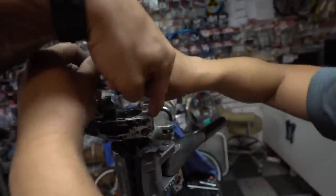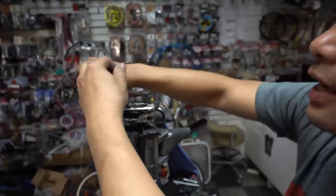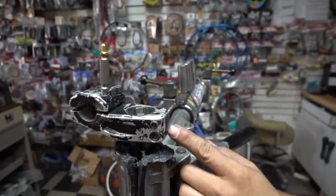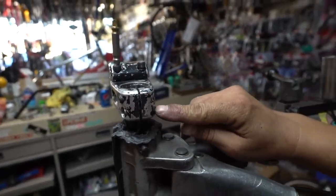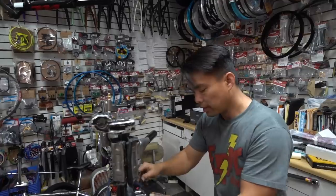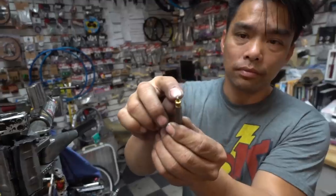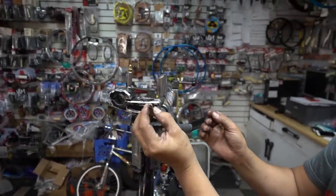Question: if this bolt was in the back, would you do that or just cut it? If it was in the back and you did not have these tools at home, yeah, you would cut it — you would put a grinder right there and cut it. But that would leave the body of the bolt inside, so then you'd have to drill into it. Use the smaller one, put that in, drill a little pilot hole right there, and put this thing in to bite it.